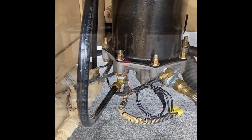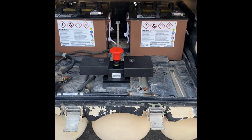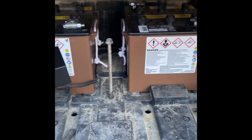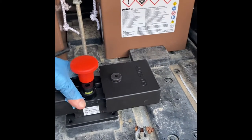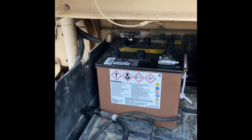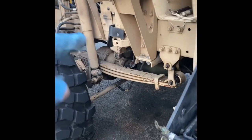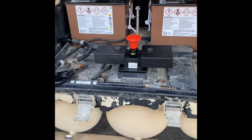All right, so I've got a battery kill switch now and I'm setting this up for two batteries. I'm going to have my battery kill switch right here — ironically, this little corner post that used to hold the batteries in place makes a real good fit for the kill switch base. I'm going to run the starter direct to the starter, so I'm not going to put the starter in the direction of the kill switch. The kill switch is only going to go to the polarity box for the 24-volt and 12-volt loads.